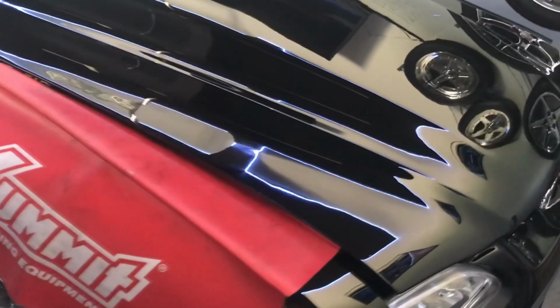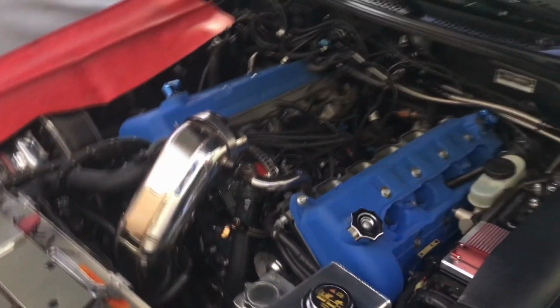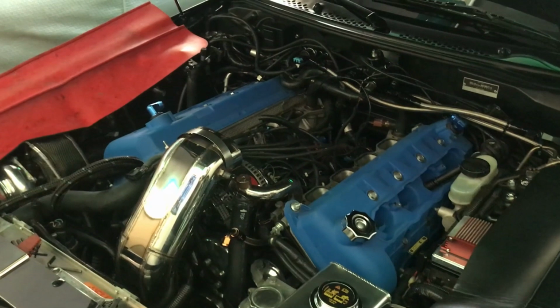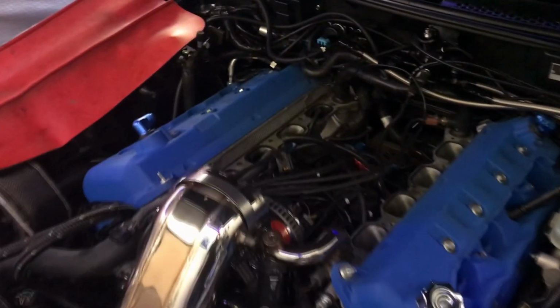And while we're here, let's give you a quick teaser about it. So, currently, sans intake manifold. But there you go. So, next video, talk about the intake manifold, how the intake had to be modified because it was a Sullivan intake for a Navigator, but the Navigator ports don't line up to a Ford GT set of heads, which is the supercar heads.